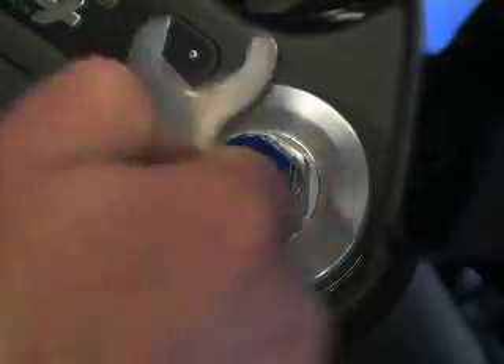Preload on the bike sets the attitude of the bike. Based on whether the front is high or low or the back is high or low, that really changes the sharpness of the handling and defines the characteristics of the bike. The front preload adjuster is at the top of the fork — it's the outer hex, 19 millimeter hex shape. That adjustment is done by backing it out counterclockwise until it bottoms and then counting the number of turns in to get to your desired setting.